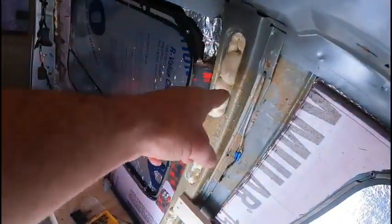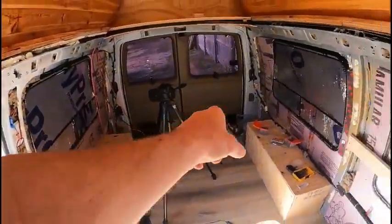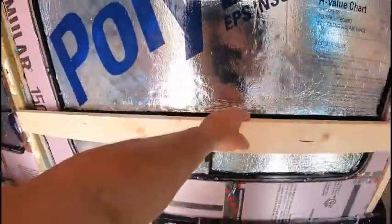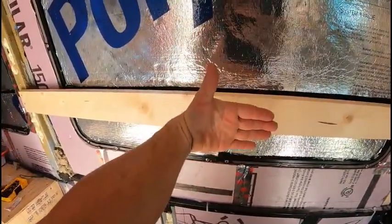So in Chevy Express vans, there normally are metal studs, like this one right here, on the walls. Well, in these Chevy conversion vans, they have these big windows put in them, deleting all of the metal studs. So you have to figure out how to frame the walls, but I think I found another way to do it. I have this piece of wood right here, which will draw the wood into the wall instead of letting it come out here like this.